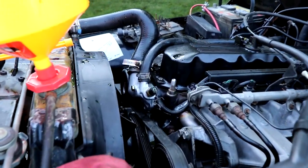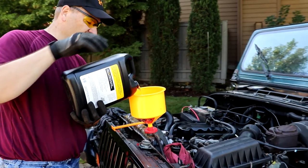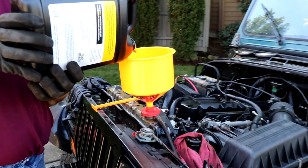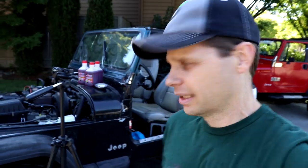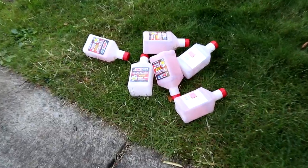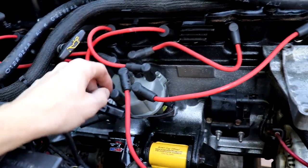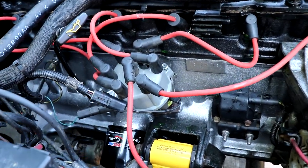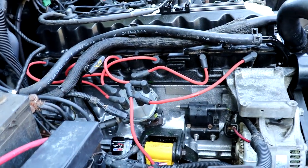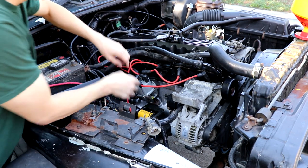Jason has the coolant filled and he attached the heater core hose. Now we're going to overfill this funnel so that it can burp — when the thermostat opens up, it'll suck in more of this fluid. Make yourself a checklist as you go through the startup procedure. The last thing you want to do is forget one of these crucial steps. Check your oil plug, filter, oil — just go through each system in your head and double, triple check everything. I've got 6 quarts of oil in. Next, we are going to manually prime the whole oil system. To do that, we're going to remove the distributor, put a drill down in there, and spin the oil pump with the drill — that primes the entire system. Because this was completely dry of oil, we want to make sure we fill all the oil galleries and bearings with good oil.